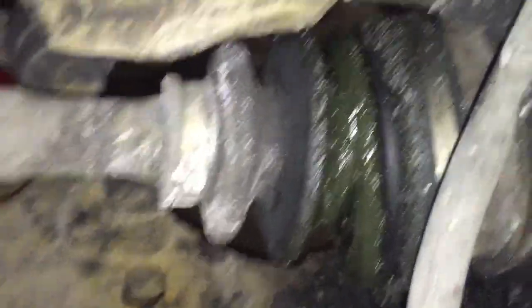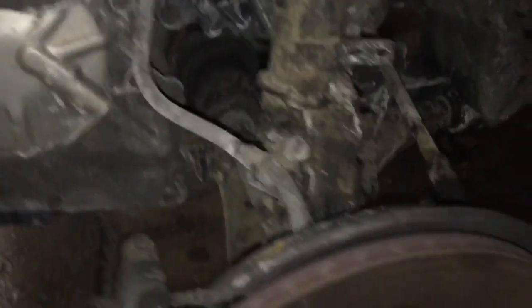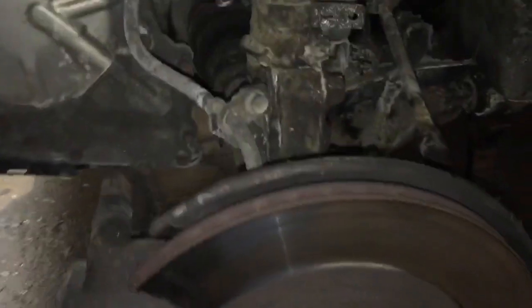The Toyota RAV4 is in the garage, wheels are off on both sides. Everything looks to be fine on one side from what I can see, but if we come over to this side — there's the problem. That's the clicking issue they were hearing. We're going to need a new CV axle. Hopefully the parts store can get me one in quick, so let's make some calls before we start tearing this thing apart.